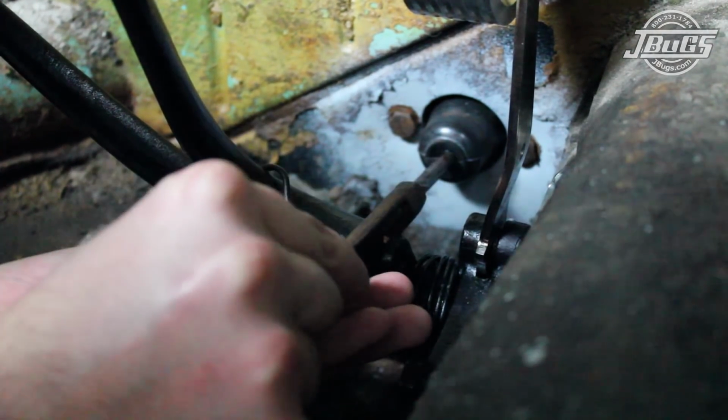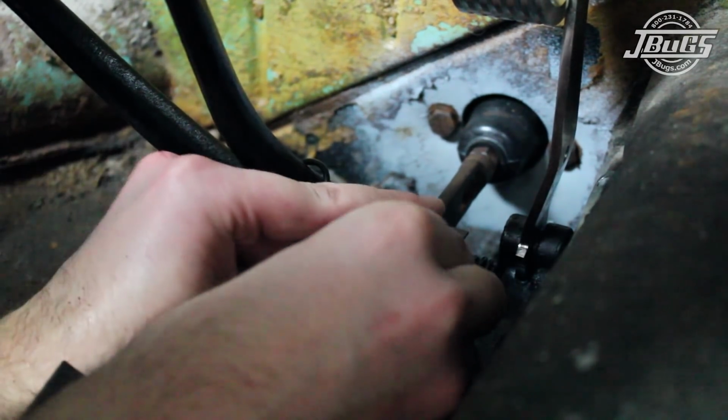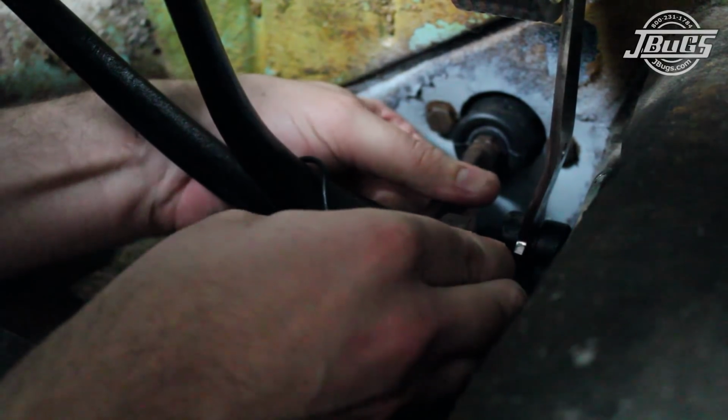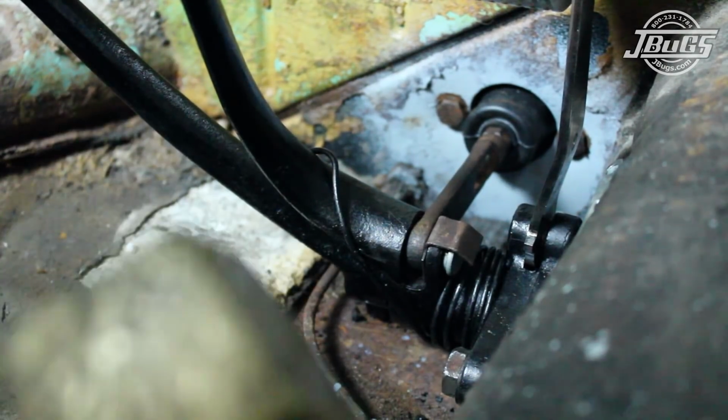And next, the brake pedal pushrod is greased lightly and slid into the master cylinder. The brake pedal pushrod clip is positioned next to it on the pedal. Then the brake pedal pushrod pin is slid into place and seated with the help of a chisel. Then the clip is tapped down with a hammer and bent over the chisel to complete the installation.